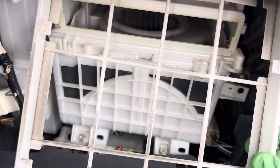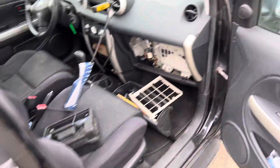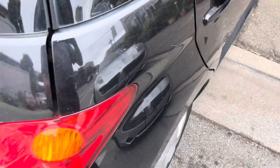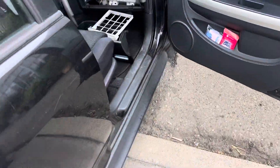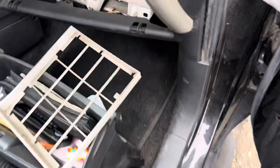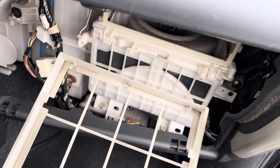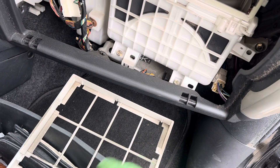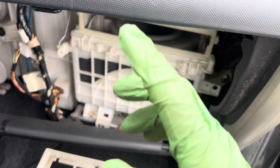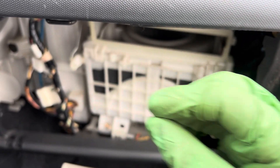This is what I did not want to find. We're back on this 2004 Scion xA. I went to go check their cabin filter and there is none. On these new high efficiency micro-channel critical charged systems, you do not want to leave out the cabin filter, because the fine fins and how tightly they are packed clog very easily.